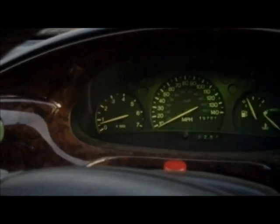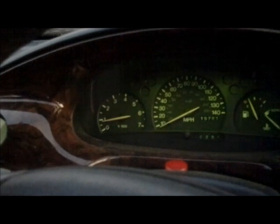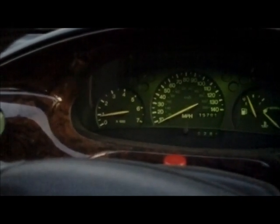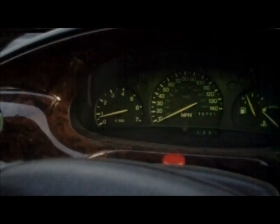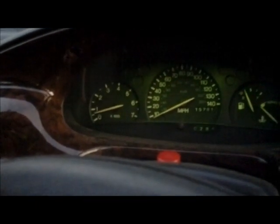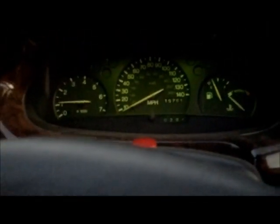But as you can see it just goes up, and if I give it a sudden rev it will drop way down low and probably stall — very close. So what I've got is a faulty idle control valve, and this is what they look like.